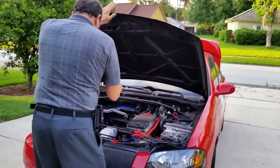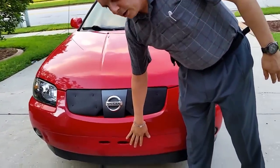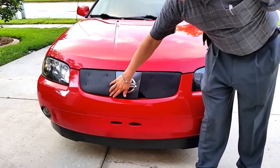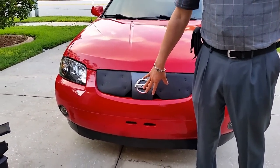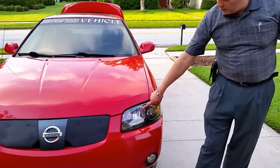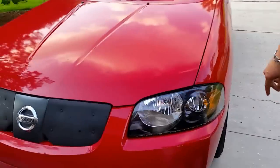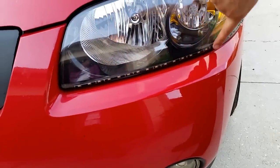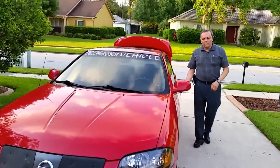Since there's no longer a huge radiator to cool, I decided to cover the front vents and installed a Chevy Volt air dam on the lower part, leaving just a little space for airflow to the condenser. By doing this I gained about 10 to 15 percent efficiency, especially on the highway. I also replaced the lights with LED headlamp bulbs and green LED lights. I also installed some LEDs to make it noticeable when the car is running, because electric cars are so quiet that I might leave it on unintentionally.